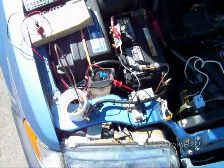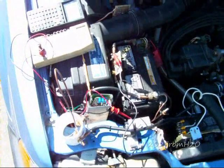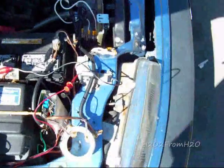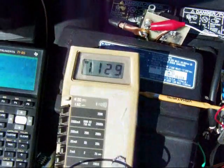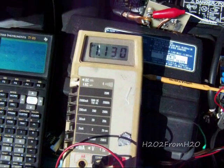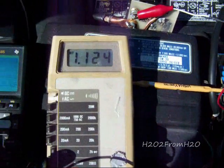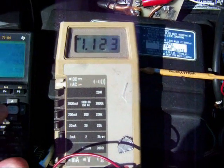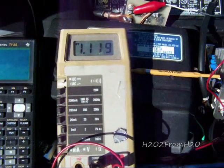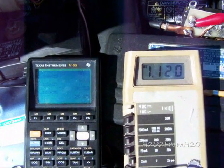The car is running, producing about 13.5 volts from the old meter. I'm currently reading 1.127 on the current HE. I take that and multiply it by 25, and that comes out to be 28.1 — round up, 28.2 amps.